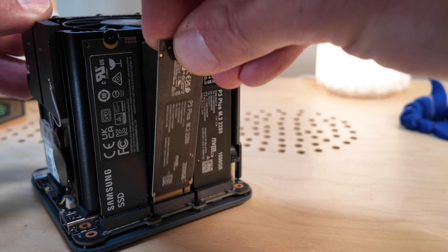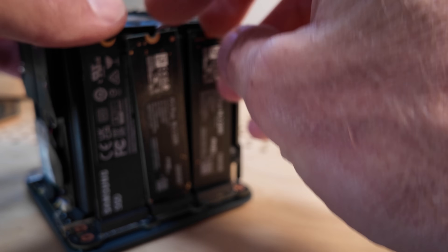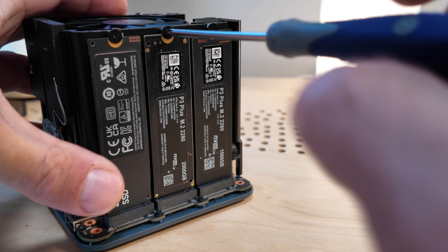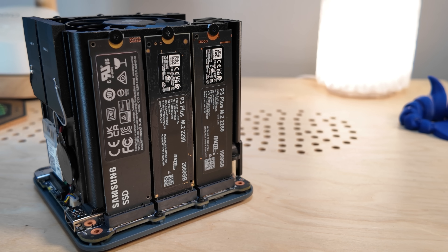Here's where reality sets in though. The RAM and CPU are soldered on the board, so forget about upgrading in the future. Those NVMe slots are a bummer — one has Gen 4 speeds and the others are Gen 3, and that's just a physical lane limitation of the N150 processor; there's nothing you can do about it. While you can fill this thing full of drives, recognize that only slot four is going to get those fast Gen 4 speeds.